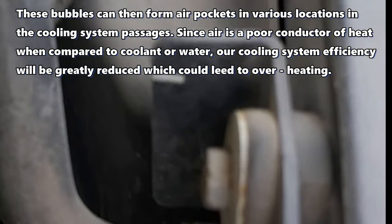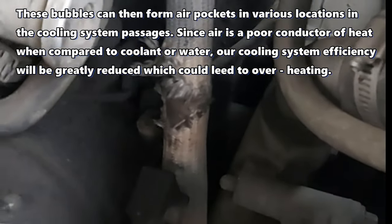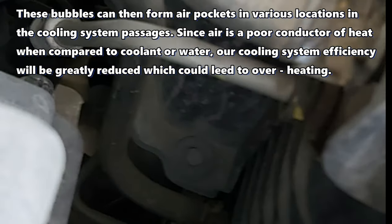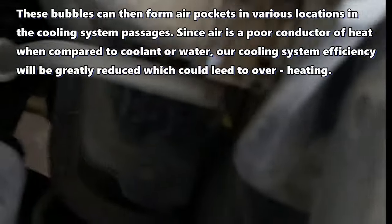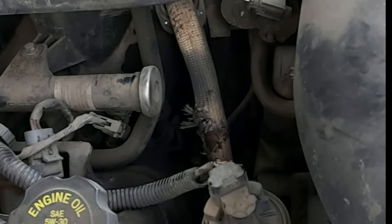For performance guys, turbocharged LS builds, and swaps, we don't even need that anymore because we don't drive our cars in cold weather. So what we're gonna do is drill and tap a hole into the top of the water pump, which is about the same height where the steam line goes into the radiator — or maybe a little bit higher, which is even better. We're gonna take that steam line hose and just plumb it into the top of the water pump, which eliminates the steam line routing through the throttle body and makes for a nice clean installation.